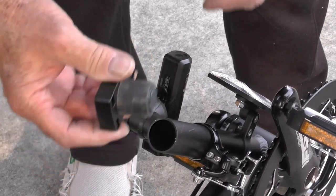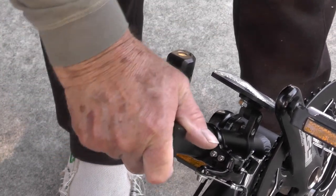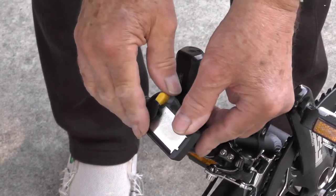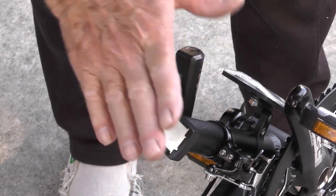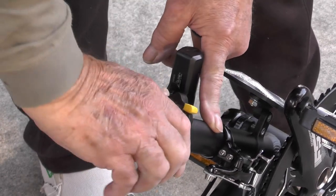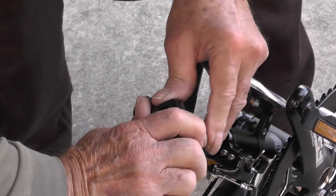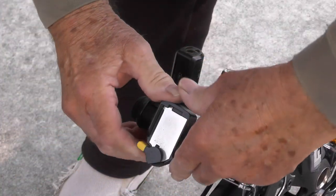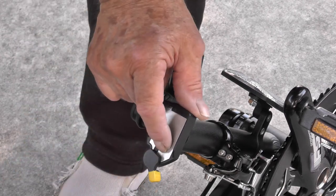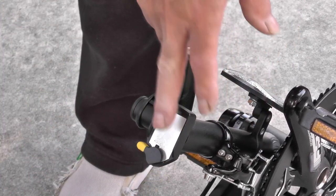And that's a pretty good fit for the first time, but it's snug. If it's snug like that, wind it as you push it in. We're going to be leaving about a 16th of an inch of rubber bung showing underneath here, so when this is pinched down, it'll make a little gasket so that we won't have metal to metal contact. Most people prefer the lever on the downside or 6 o'clock position. It's just easier to get to perhaps from the seat. So our bung and our quick disconnect is installed.